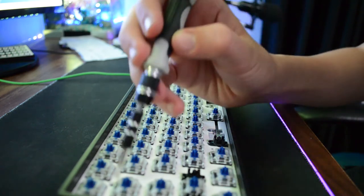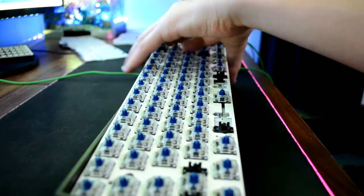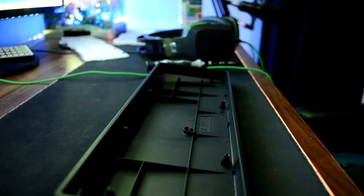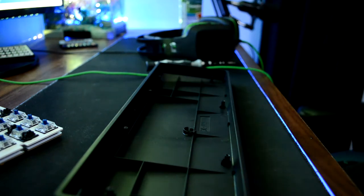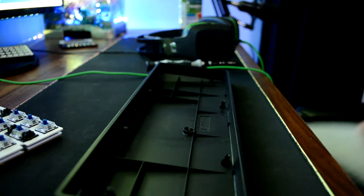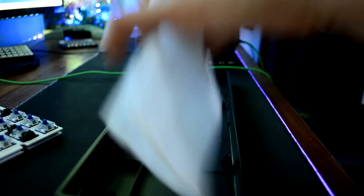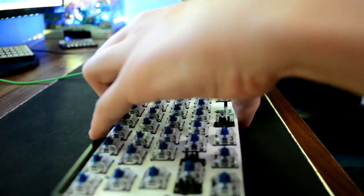Here are the steps for putting foam in the back of your keyboard — pretty simple. All you have to do is take the screws off your PCB so it's not screwed in. Then you pull up from the bottom of your PCB to take it out, and carefully grab from the top as well because you don't want to break your USB Type-C port or whatever you have on your keyboard — it differs from keyboard to keyboard. I have a GK61, so it's going to change for yours if you don't. Next, get your pre-cut foam cut to scale for the inside of your case. As you push it down, the holes for the screws should poke through the foam depending on how thick it is. If you have a thicker piece of foam, maybe pre-cut those out. Put the foam down, then put the PCB back on and screw it back in.